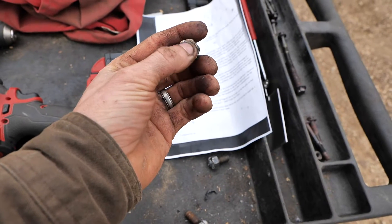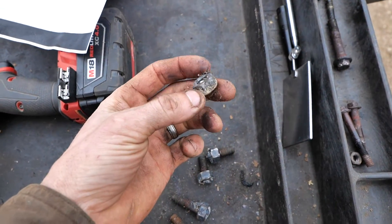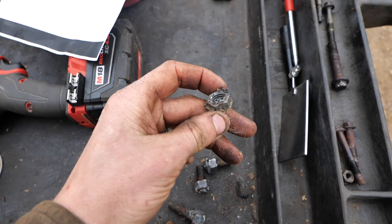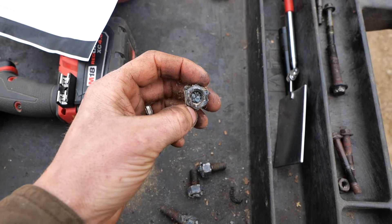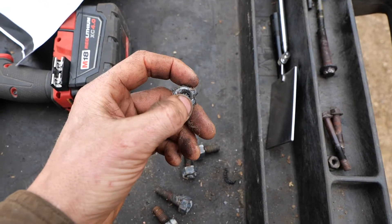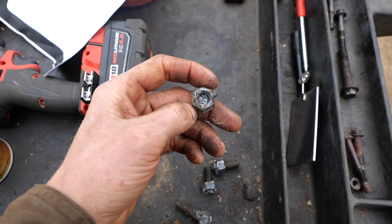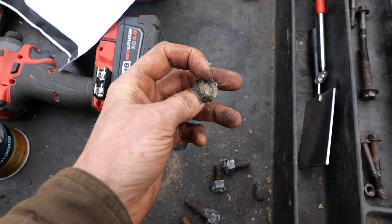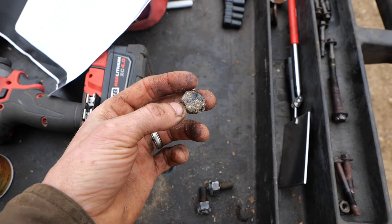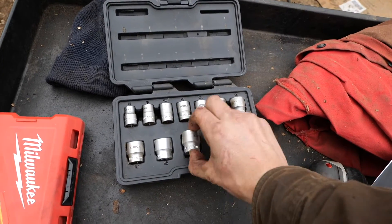You have to try to get a lot of weld to the center of the bolt — that's always the part that doesn't seem to get enough weld. The nut's going to end up welded because you fill in that pocket. I've twisted off three or four nuts that didn't get welded properly — that's aggravating because you have to do it again. You should be able to turn these out red hot. On the ones I succeeded at, I welded directly in the center for a long time, got the stud nice and hot, then went around the outer edges. Since there were no heads on the bolts once I cut them off, they're able to turn in or out a little bit, which helps a lot.